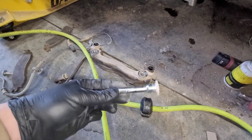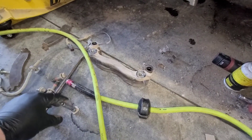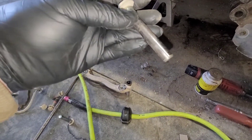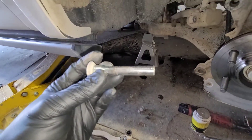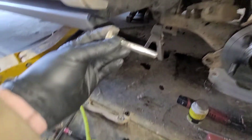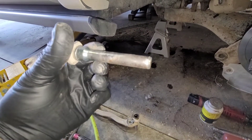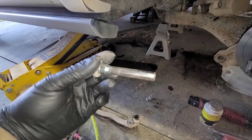This pin looks fine - I've got all the old grease off of it, it's still shiny, it's still clean, there's no corrosion. That was for the top of the caliper. The bottom side - that's not grease, that is rust. That's the beginning of corrosion. What happens is these things sit horizontally inside that housing, especially on vehicles that sit for a long period of time. Water will build up inside the caliper bracket; it'll leak past these boots sometimes. And when that happens, you'll get exactly what we're looking at here - corrosion on one side of the pin.